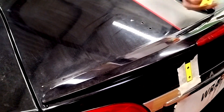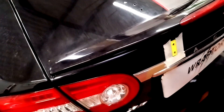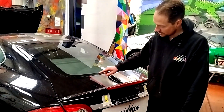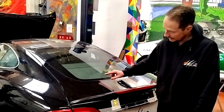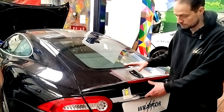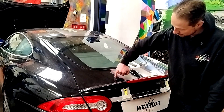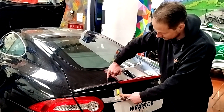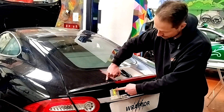That'll leave you something looking like that. It's a good idea to put a bit of paint on the exposed metal to stop corrosion. Some of the holes were double-skinned, so that means you have to drill through one layer and then carry on and drill through the next layer of metal, which is like the frame for the boot lid tailgate. That hole was a double-skinned one, and that one as well — same on the other side. Those two holes were not just one layer.